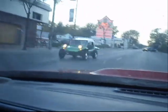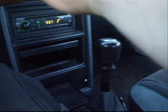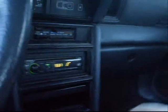Hey, cool. Check it out. That's the beast. Pop out of second, or are we going to stay in second gear for me? Hey, that's the issue right now. It doesn't like second gear when you're downshifting. Upshifting's fine, it stays right where it's supposed to be. Stiff into third, so I think I just have to realign it a bit. It's also really stiff left to right. So, a little bit of tweaking.